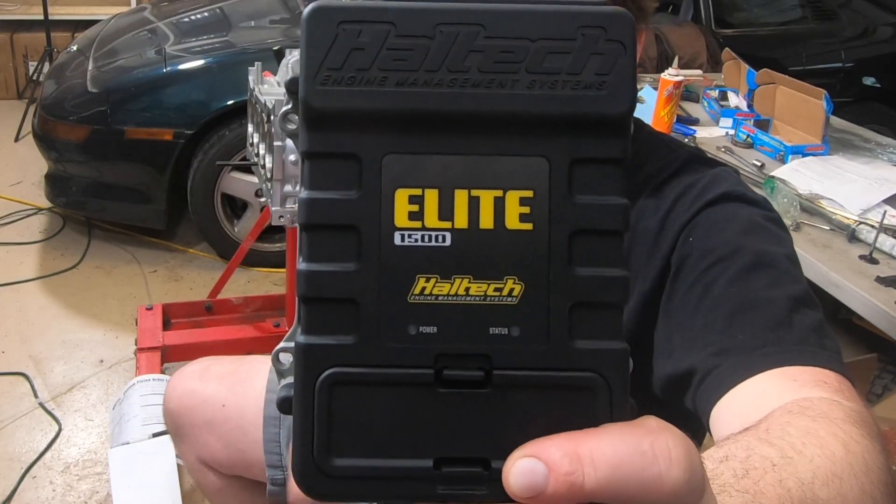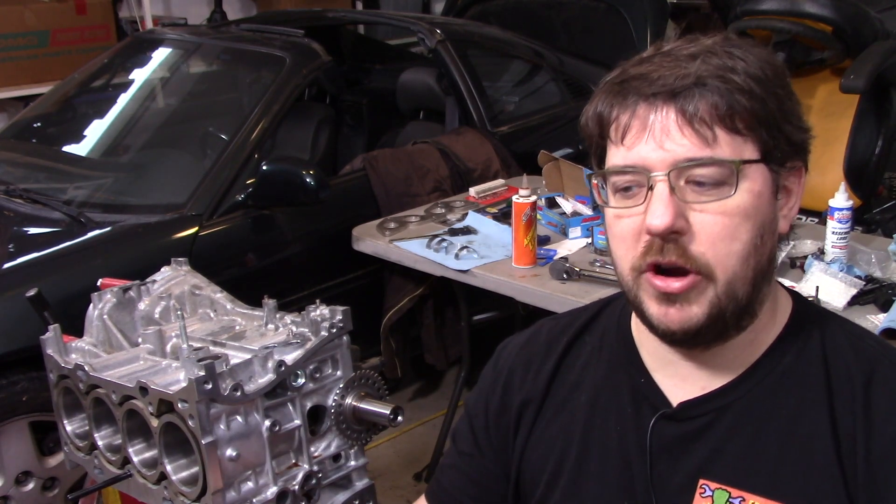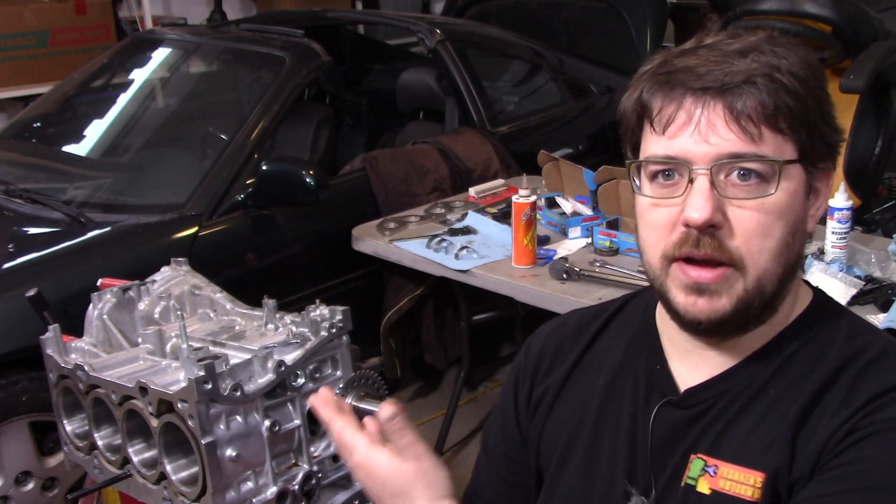Another decision I've made is to order this aftermarket ECU. My intention is to actually use the stock ECU when this thing is finally running. But the issue I'm concerned about is that the exhaust VVTi constantly has to fight oil pressure against the position it wants to be at higher RPM — they actually rotate in opposite directions. On the intake side, the VVTi is actually taking itself out, so even if it's not strong enough to apply change at 8,000–8,500 RPM, it doesn't matter because we want it sitting against the idle position. But if we lose control of the exhaust, it'll go 40 degrees in the wrong direction. By using this, I'll be able to monitor not just the target but also the actual — and that's going to be really critical. Once I get the timing, fueling tables, and VVTi stuff determined, I'll transfer that tune back to the stock ECU, because my intention is to make that tune available if anybody else wants to build one of these.